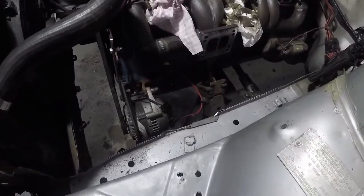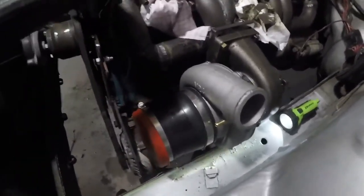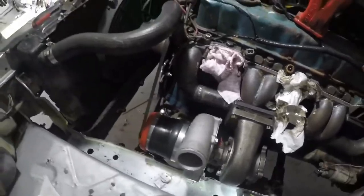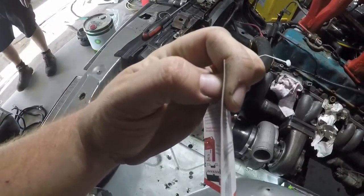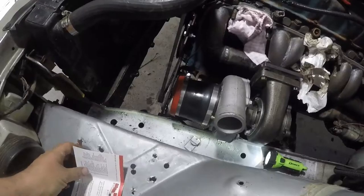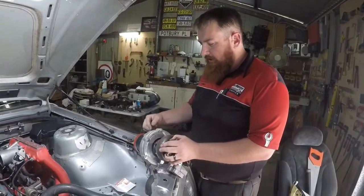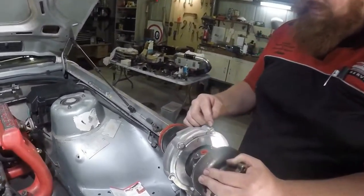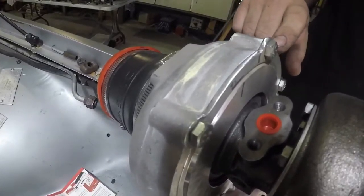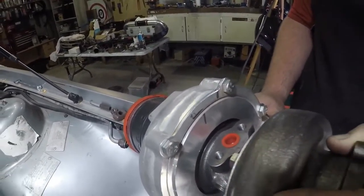Just that much clearance — let's hope it fits. Well, it's in, so that's better than yesterday. It's got this much clearance though, so we're going to grind the side of the turbo with the grinder so it's got more than this much. We'll add the clearance a little bit from this bolt. One bolt is a fair bit thinner than the other, so that should give us a little bit more clearance and stop it from rubbing — while it's not running anyway.